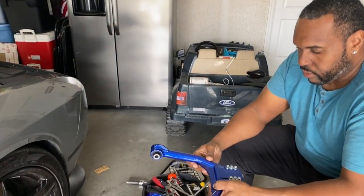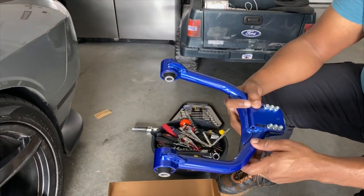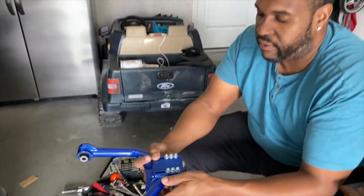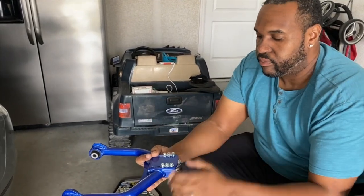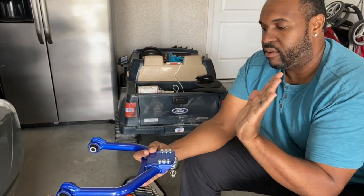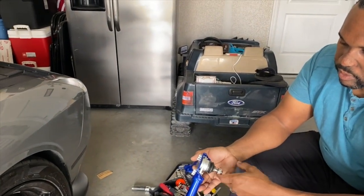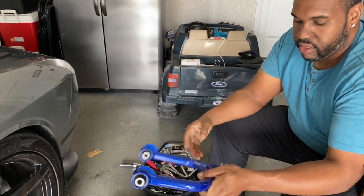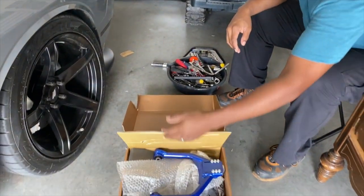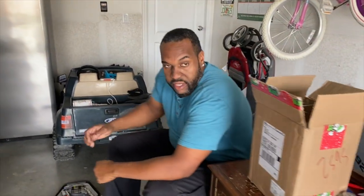Here it is guys — I haven't even opened them yet. Megan Racing. Looks like the right one. This is for the left side, but I took this side of the box. Pretty much what it does — it just replaces it just like factory, and now you're able to adjust this back and forward. So once you slide this back and forward, that changes the angling of the wheel. The more forward it is, the more the wheel's out. The more in, the more cambered in it is. That's what this is made to do. Would you recommend this if you're lowered or staggered? Yeah, especially if you're having a staggered setup and you can't rotate your tires, I would recommend these. They also make SPC as another brand. It makes sense — it helps you save tires.